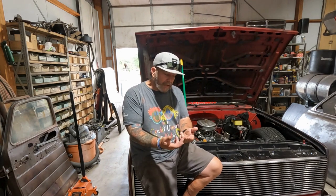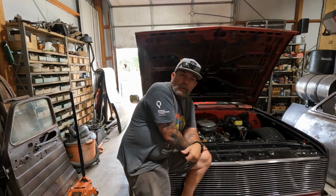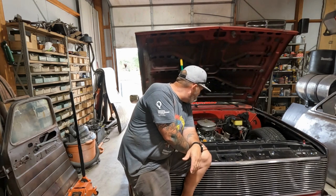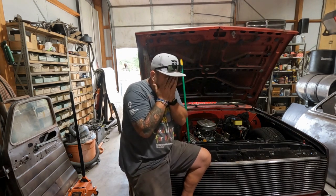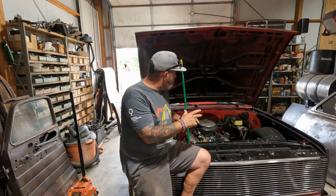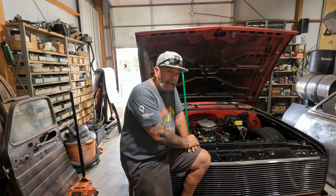This is where it felt like it was coming out from, right behind one of the clamps. So the intake bolts are tight. The carb bolts are tight. There's not a vacuum leak on top of it. I don't absolutely know that it wouldn't be that switch, but I know the throttle response feels way better now. I'm just going to kind of go with the good Lord kept us alive.